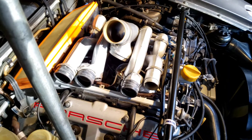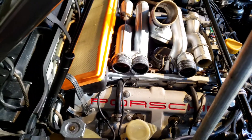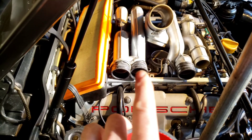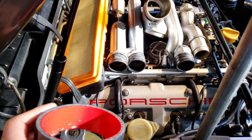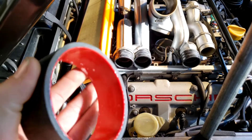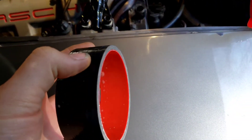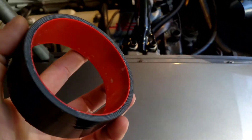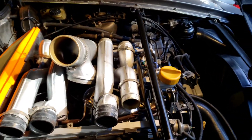In the process of getting the T back on, I found a couple of things that can really help. Normally getting to this T means removing some of the other intakes, but I wanted to find a way to do this without removing the fuel rails. With the new piece, what I do is take just a slight amount of water and Dawn solution to make the inside of the silicone ring a little slick, which helps fish it back on — and more importantly helps get the T back on.